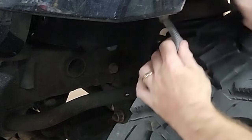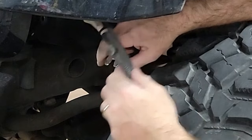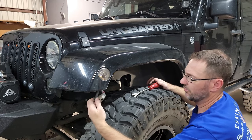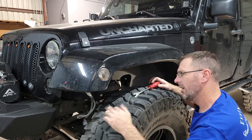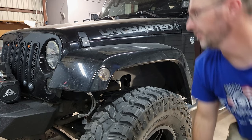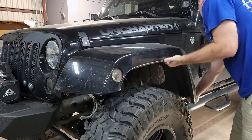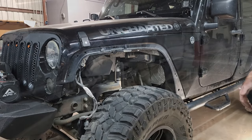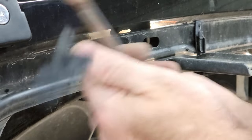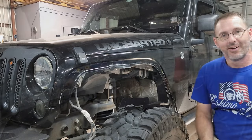Make sure that you pull your light — it's got a little Christmas tree type peg — make sure you pull that out before you start yanking. I do have the Quadratec pre-runner light kit so that's why you see the extra wire harness there; otherwise you would just have a standard plug right to the light. Let's go ahead and yank and see what happens.